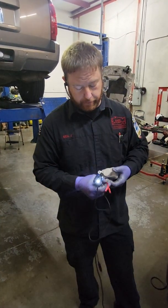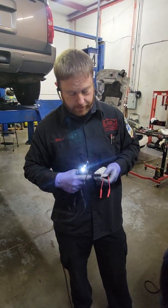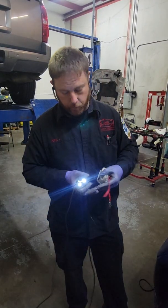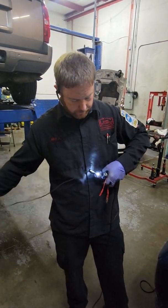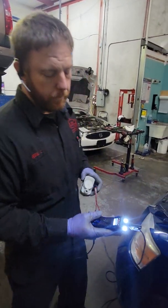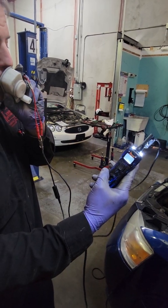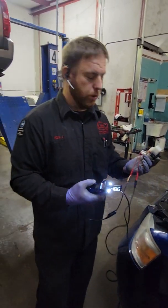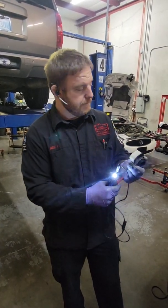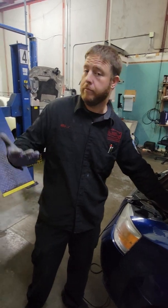Here's one that came off the vehicle — we confirmed there were no leaks, and this was tested and deemed defective. Same way: ground on one pin, another lead on the other pin. Should have nothing there. I'm going to blow — nothing. And I'm going to suck — I can hear the weights moving, but nothing's working. Most likely the switch inside is bad internally. That's a quick, easy test to prove out if the leak detection pump is good or bad.